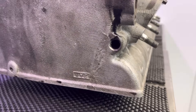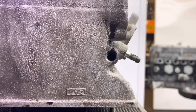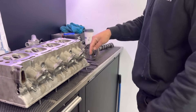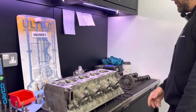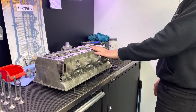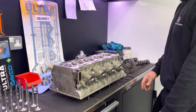Back to that cylinder head on the Cosworth - look at that, you can't even see through it! Absolutely clogged. The oil gallery runs from the head, feeds down there and then feeds the hydraulics. You'd probably end up with either noisy hydraulics or a hydraulic running dry in the head and ripping the thing to bits. So yeah, took all the valves out, going to give it a good clean and wire brush. Not going to bother blasting it because the head face has been done - only had 30 thou off the head, which is pretty good for one of these.